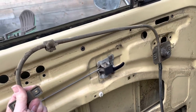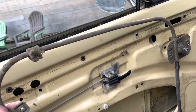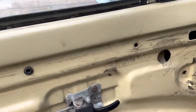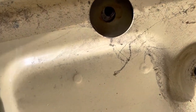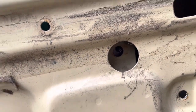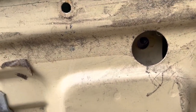That took maybe two minutes to get out. Take your watches off and hopefully you have small hands. I took the bolt out and then used my big screwdriver to get it between the layers. You can get the screwdriver between that silver layer and the painted layer and give yourself a little bit of space, and you can pull the window crank and regulator through there — you only need like a quarter inch of space. How I'm getting it back up there, we'll see. Hopefully it's just as easy.